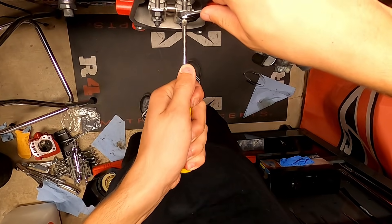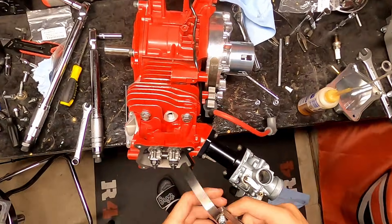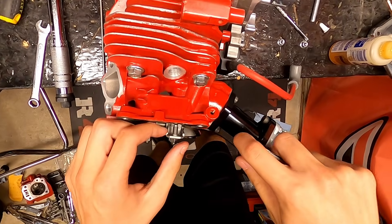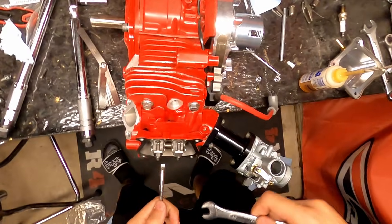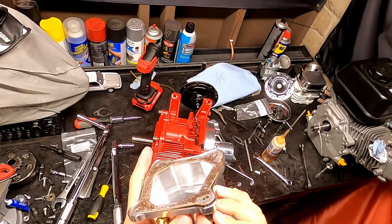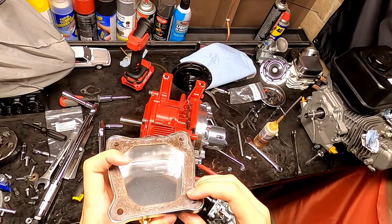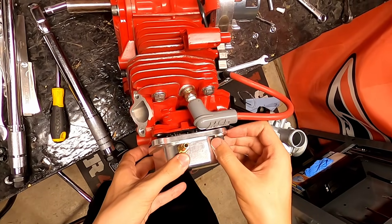My personal preference is 0.002 inches — tighter is always better for these mini bikes and rocker arms. That said, you don't want it too tight either; you still want a gap with some resistance. Once the valve lash is 100% set, go ahead and start up your bike, make sure it's running good with no issues, then throw your valve cover back on and you're done.